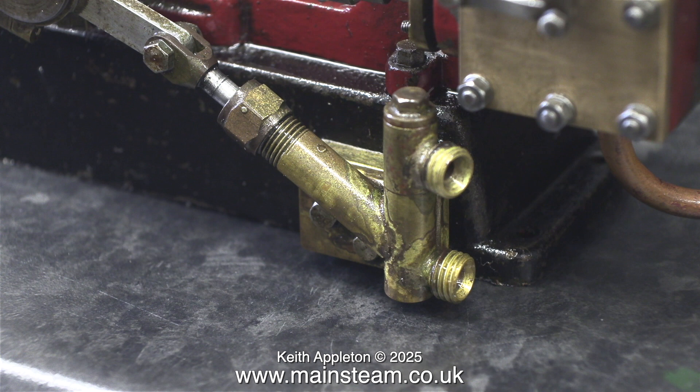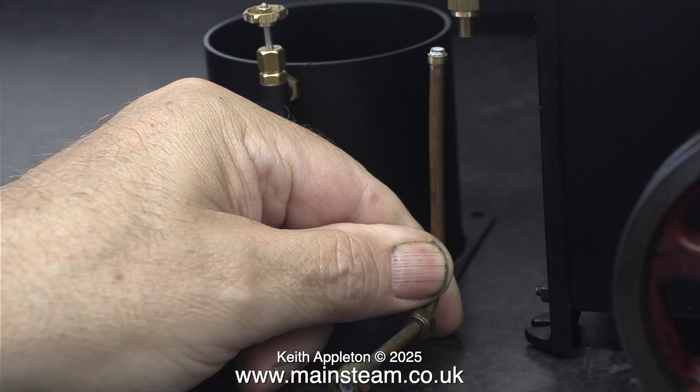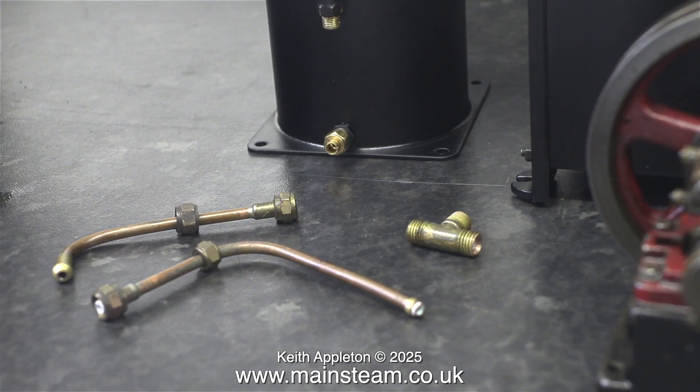All this piping will need to be made to go round the back of the engine and eventually arrive at the inlet and outlet of the water pump. A piece of 5/32-inch pipe, very similar to this one, will carry the water from the T-piece up to the check valve. I'll be able to use all of these parts with the exception of the actual pipe itself.